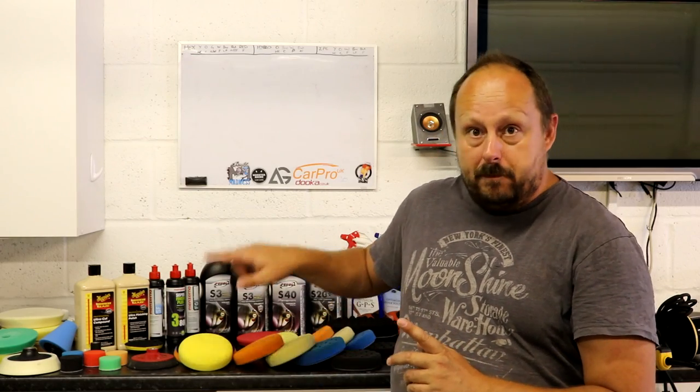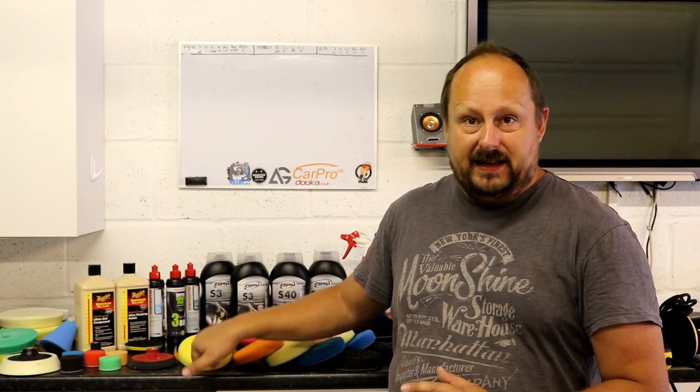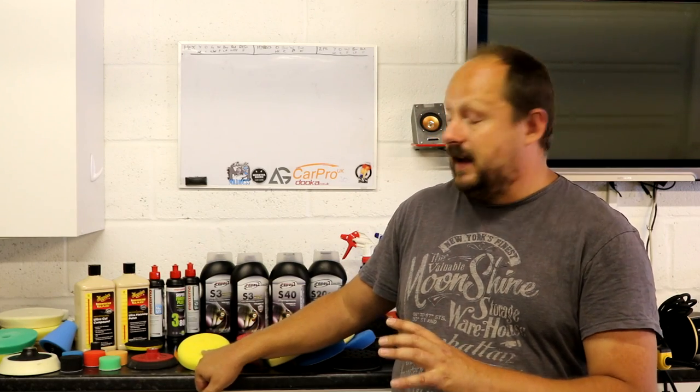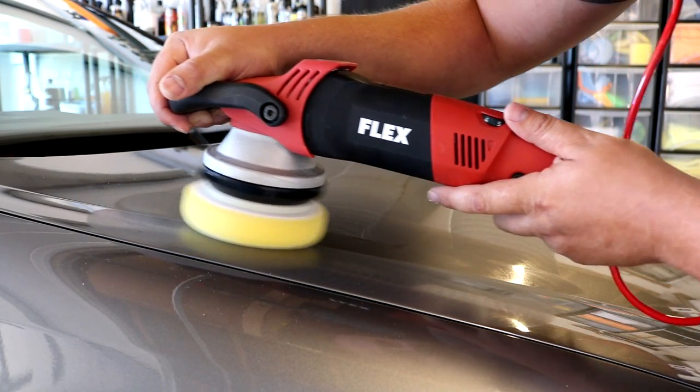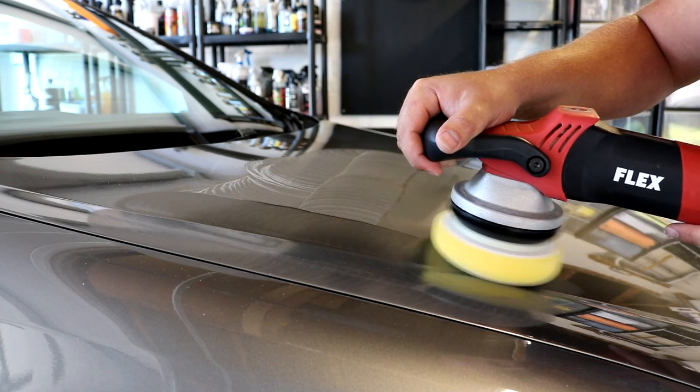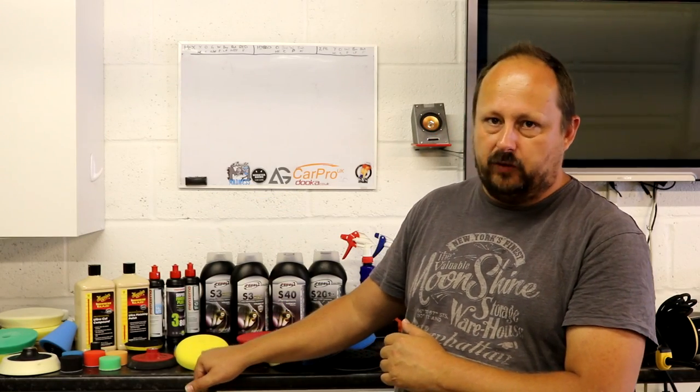The main difference between these and a premium pad is that even their heaviest, most coarse cutting pad is very soft compared to premium cutting pads from other manufacturers. If you're going to get cutting pads, get their most extreme version - the yellow - which they call Ultra Cut, totally aggressive, for old heavily damaged paint. But even that is too soft for a cutting pad. The ones I use are a lot stiffer than that. You can buy 10 yellow ones for £23, which is £2.30 a pad.